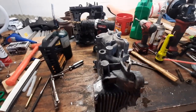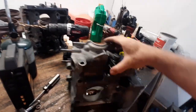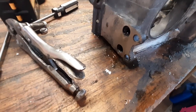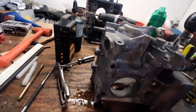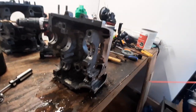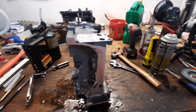In case you're interested and want to visualize this a little better: this right here is the outlet for the oil pump. Like I was saying, it comes right up to here at the top of the piston. It goes to your oil cooler and also branches off across here to your pressure sensor. Then it goes through the oil cooler, comes out the back where it would go to the back mains, and also sprays through the main bearings. Right now we need to get that piston out of there and I'll show you how it bypasses.